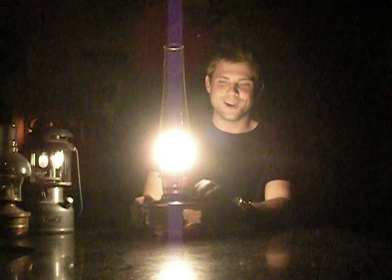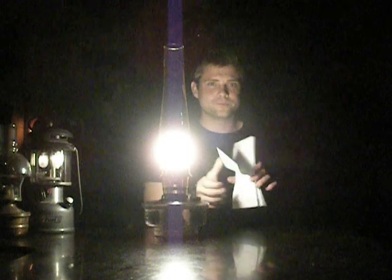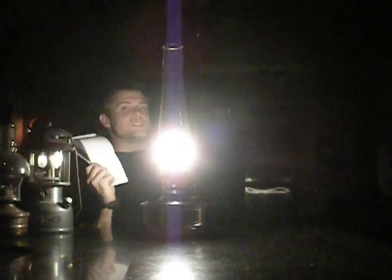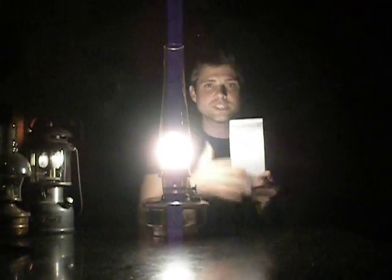Next, we're going to the Aladdin Genie 3. The Genie needs to be lit a few minutes prior to turning it all the way up, and it needs a few minutes to warm up. We go to our wick, the mantle starts to incandesce. You can go a hair higher than that, but watch it because you'll smoke it up. Great light output — here's a white sheet of paper, and you can tell it's very easy to see and very easy to read by. It lights up the whole room; you're seeing back into the back of the cabin. It's completely silent.